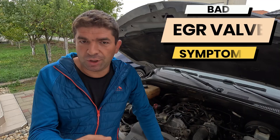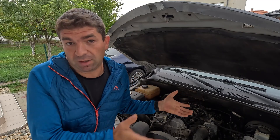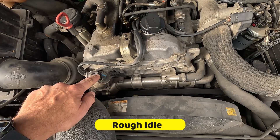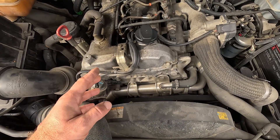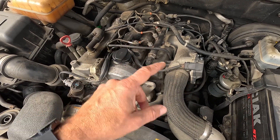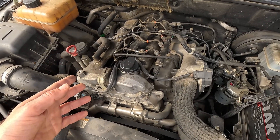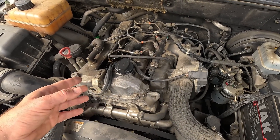Now, let's talk about what you'll actually notice when your EGR valve is going bad, because most of us don't test things until the car starts acting weird. First of all, you might notice the idle is rough — if the valve is stuck open, exhaust gases get dumped in when they're not supposed to, and your idle goes all over the place. A stuck open EGR valve might also cause stalling, as the excessive exhaust flow at low engine speeds chokes the engine and kills it. And even if this doesn't happen, your car will be down on power, because it's effectively not getting enough air to work properly.